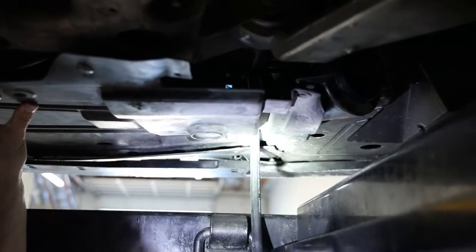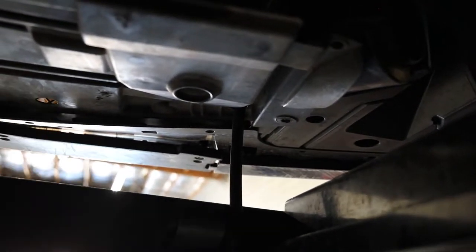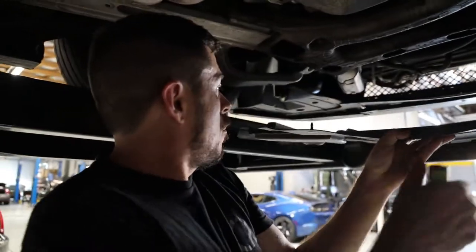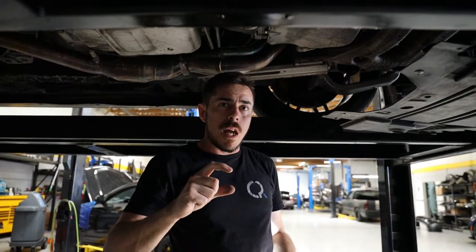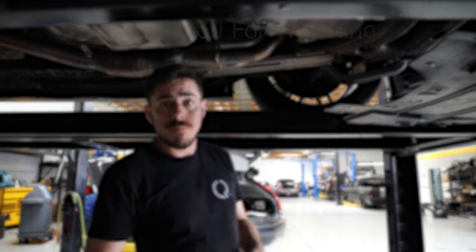That's what it'll look like — just give it a little cut right there so it's hanging down a bit and you're done. Go ahead and reinstall the strut brace, panels, and anything else you removed. Fill it up, turn the car on, and it will bleed itself — no need to worry about air pockets. Fill it to about an inch below the top of the tank so it doesn't get pressurized and come out the lid. It bleeds all the air on its own like a surge tank. And the lid is big enough to add ice if you're icing at the track.